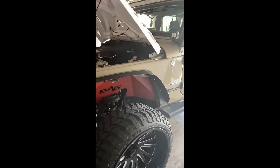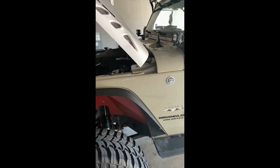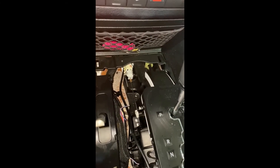So let's try the purple and dark blue wire. I snipped the purple and dark blue wire, turned the ignition on, and the traction control light stayed on — so in my case it is the purple and dark blue wire for the traction control. I'm going to add some more wire to extend it since it's a really tight fit, and connect them back together using weatherproof heat-shrink connectors.